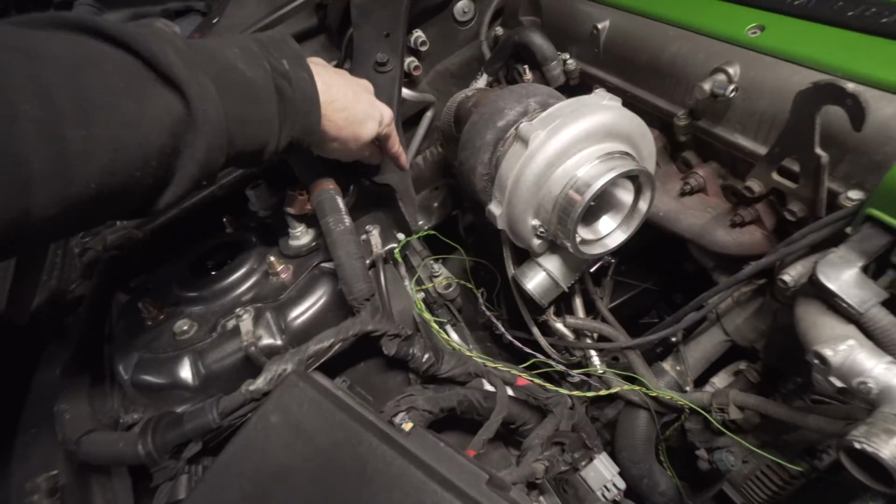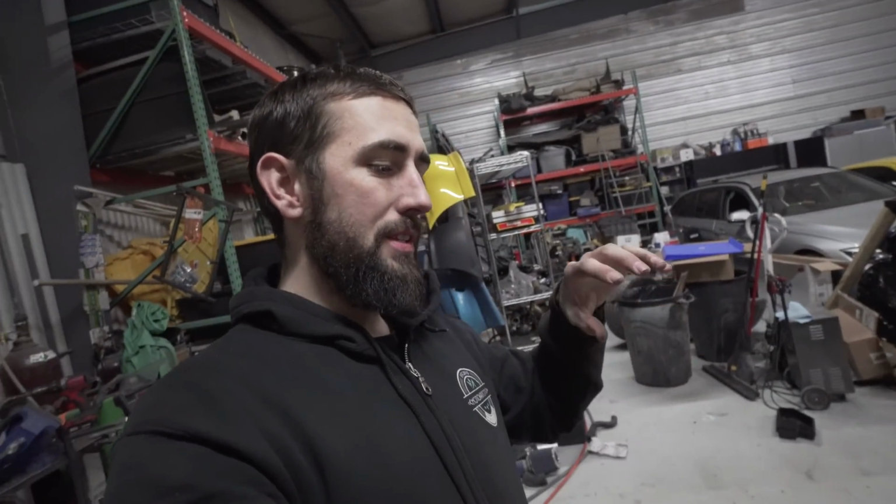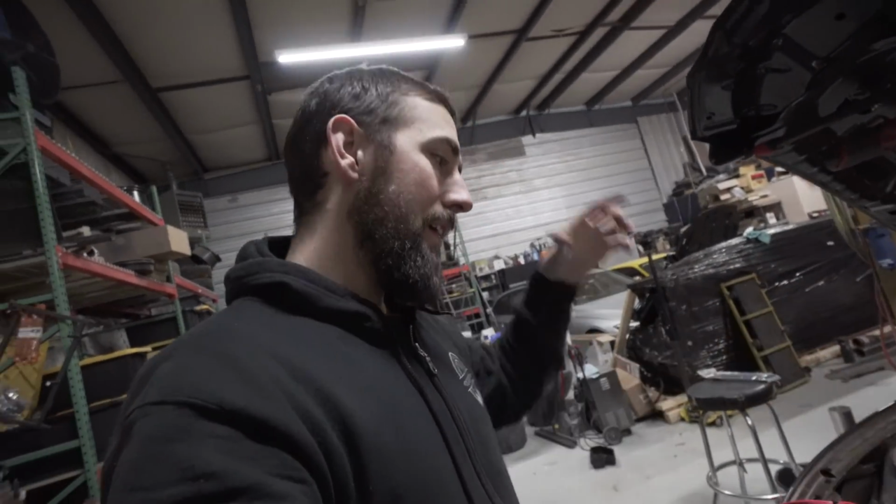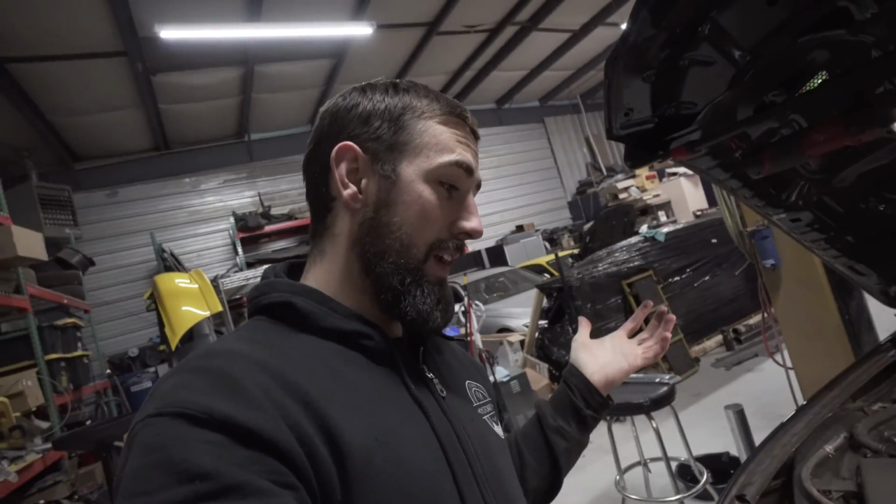We have a cylinder head temperature sensor that works. We have the air fuel ratio. I have it kind of hanging down there, basically right behind the exhaust, so it's kind of in the air. But when it wasn't plugged in, it was 14, and now it's plugged in, it's showing 20. Coolant temp isn't working, but obviously the crank position sensor for the EcoBoost, all that stuff is hooked up.